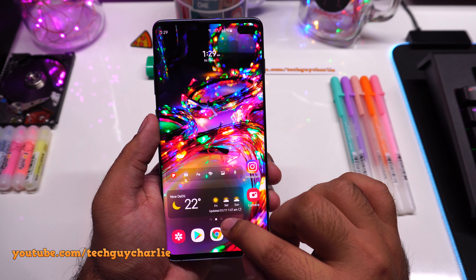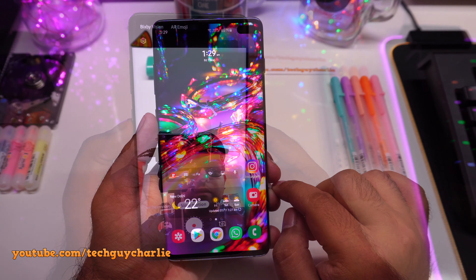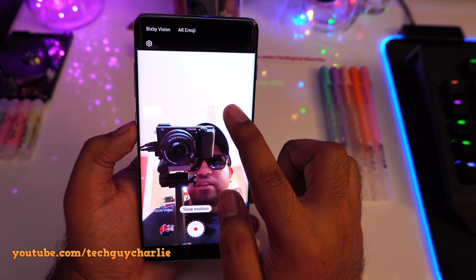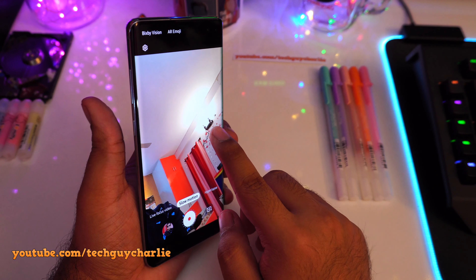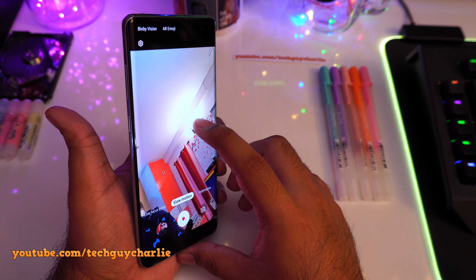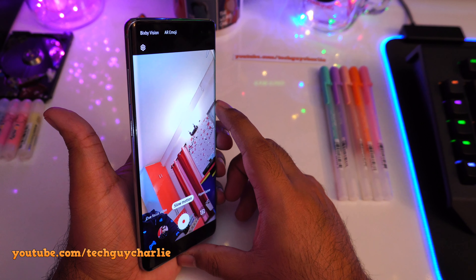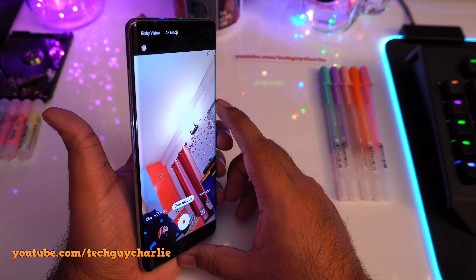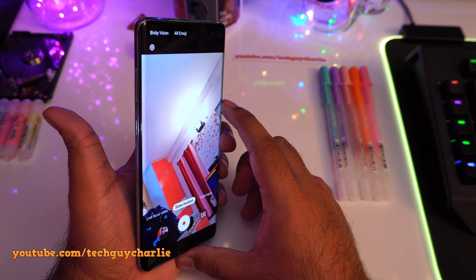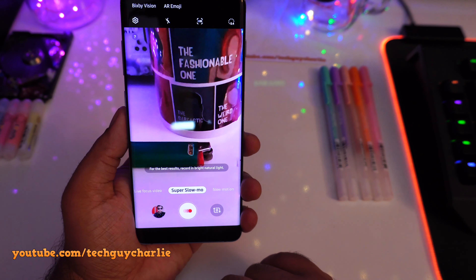The fingerprint scanner has also been updated, and there is now slow motion video on the front facing camera of the S10. Before I go, I want to point out something — you might see a slight flickering effect when you record slow motion videos indoors, especially with the lights on. This is completely normal. These lights use something called PWM, which means the lights turn on and off at an extremely high rate. Your brain is too slow to perceive that flickering, so you see it as a constant source of light, but the phone in slow motion mode is able to see that flicker.